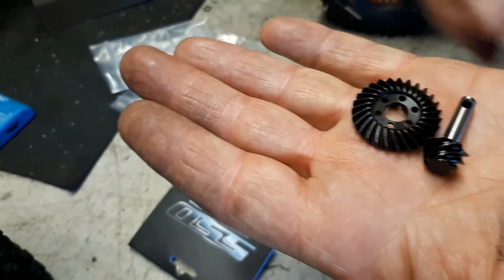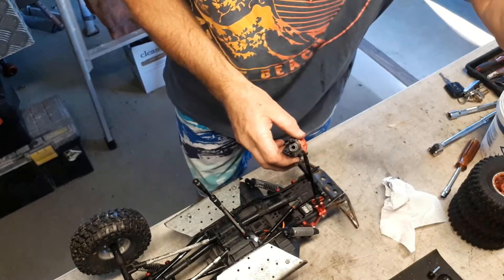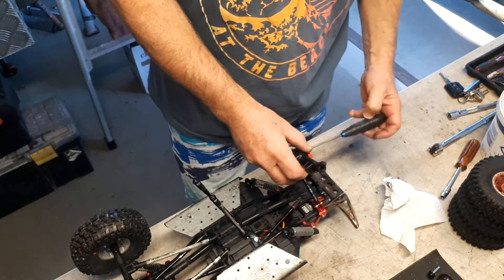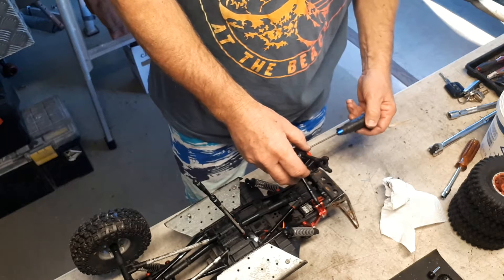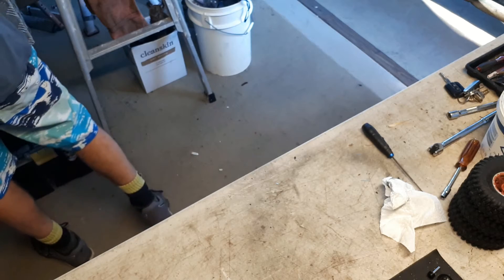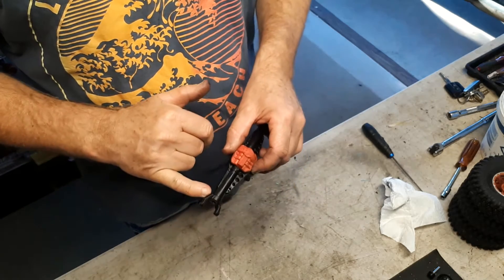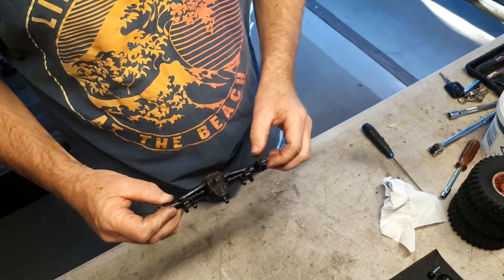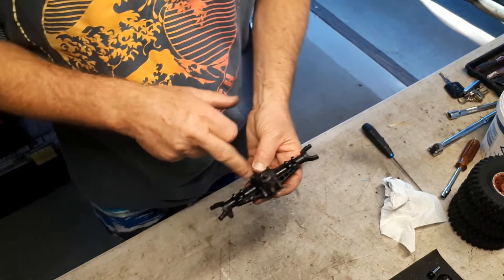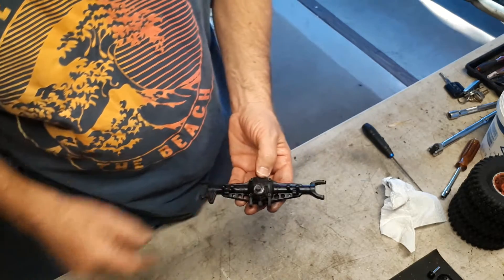They're not a cheap item, but let's face it, we love overdrive. So we're going to throw them in. I'd suggest just basically take everything off so the axle is free and nothing's going to get in your way. Get the rig out of the way. So there we have it - this one's still in good nick. We undo these four bolts at the back to get inside, this will pop out, and then we'll see what else we've got to take out, but basically the centerpiece comes out as well.